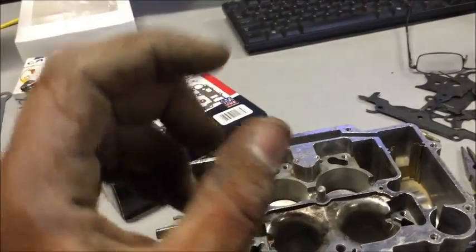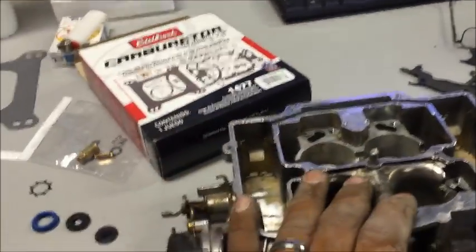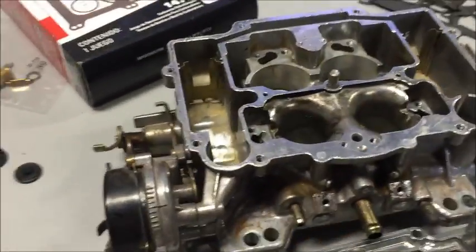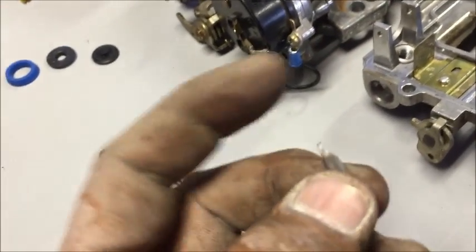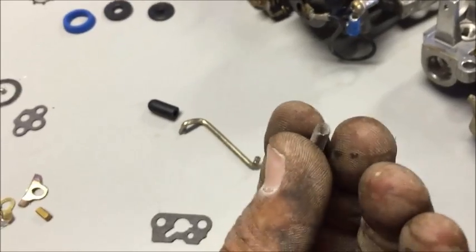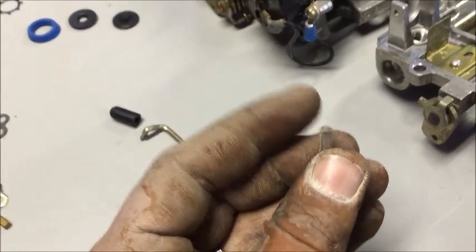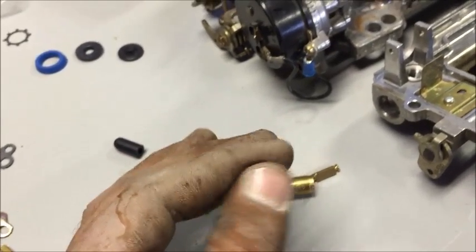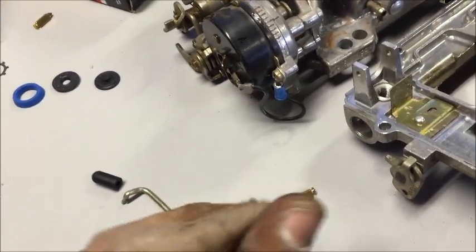You can fine tune them while it's running. While it's sitting there idling, you're going to crank them one way or the other until it's spitting or not spitting — right there in the happy medium, and that's with your ears. Now these little screens — the older ones come with a flat bottom, these ones just pinch. See the front side here, how it's all messed up? It's a pain to get in there. All you're going to do is hold the open side that's going to go in and just roll it in your fingers, and it'll roll right down and slide right in. That's the little trick to those.